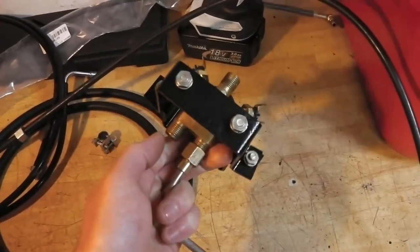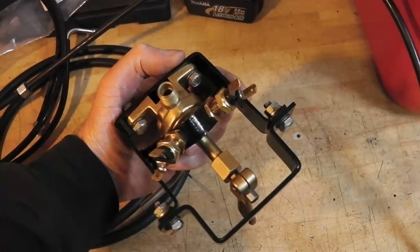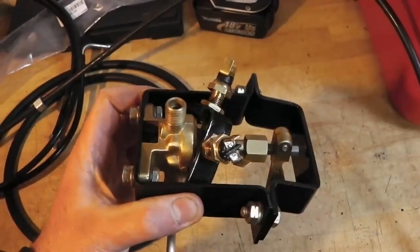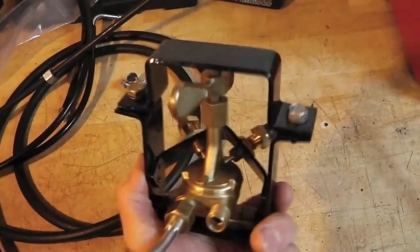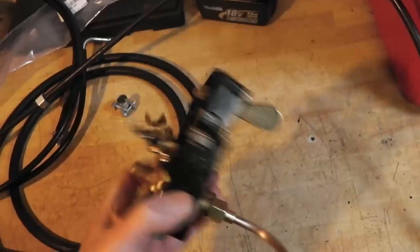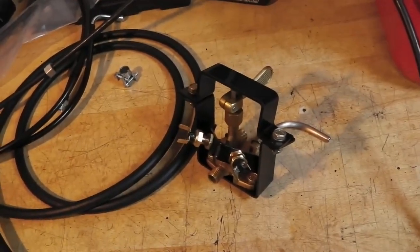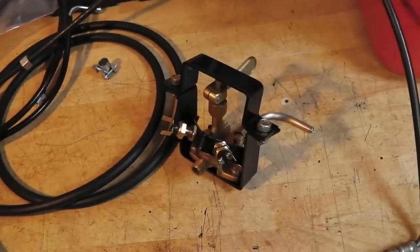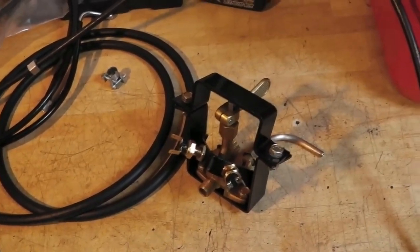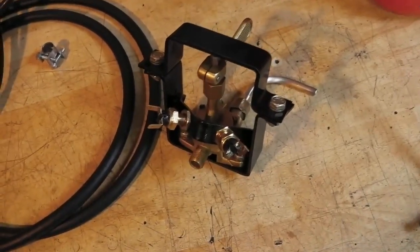So that'll be the one to the fuel pump and that'll be the one from the rear fill tank. These little valves were military fitment - nice simple Enots brass taps, they've got a cork seal in, so best avoid E10 as that does actually attack cork seals. The cork seals are available from Blanchard's. These have two little changeover switches. I believe the originals were the same as Jaguar E-type handbrake switches, but I couldn't find a cheap source - they were quite expensive, about 50 quid for a pair. So I got a pair of brake light switches at four pounds each and modified the bracket to fit them.